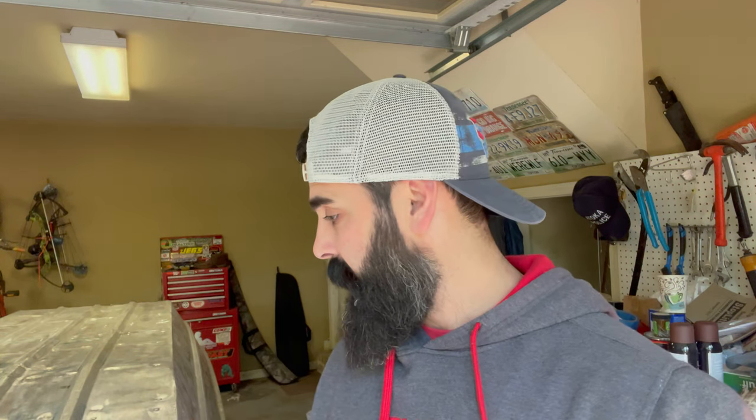In the last video, we went ahead and halfway prepped the surface of this boat because we sanded it with 80 grit, and we also washed it with soap and water and let it dry. So really, that's all that Gluvit calls for, grease and wax remover. We pretty much degreased it because I used the detergent. But since it's been sitting in here for a little bit and I would do it anyways, I'm going to go ahead and wipe down all the spots that I'm going to put this on with some acetone and then apply it. So let's go ahead and knock that out real quick.